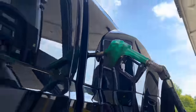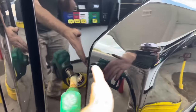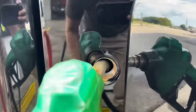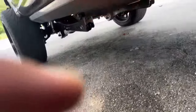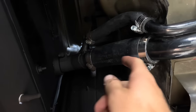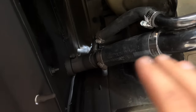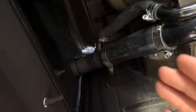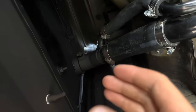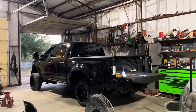Oh dude, that's wide open! That's going to work out phenomenally - it keeps it away from the fender flare so we'll be good. That is literally perfect. Underneath I put a 45-degree fitting here, welded it all up to the factory one, extended it with rubber hose, extended the breather so everything should work as normal as factory. We didn't move the fuel tank, we didn't do anything like that. This is as factory as you can get without the big huge door they come with stock.